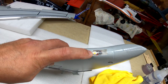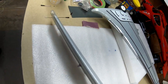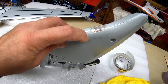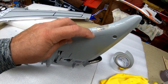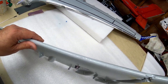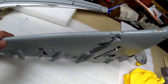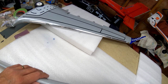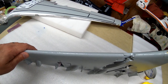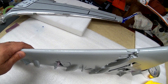So the aluminum tape, I just put a little leading edge mark on there and line it up with the LEDs down at that end and that end. Make it a little longer so you can use your fingernail and crease this, and then you can trim it away with a knife. And literally just start working very, very slowly, going down from the center to the outside edge a little bit at a time. That one there probably took an hour and a half just to lay that aluminum, because once it's on there, guys, you get one shot. And if it ain't right and if it looks bad, you're kind of stuck.